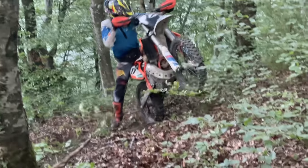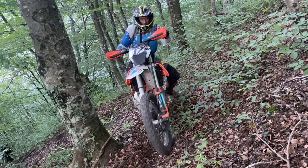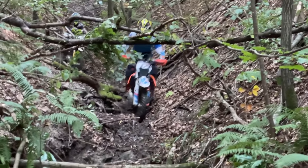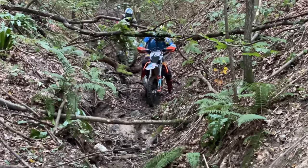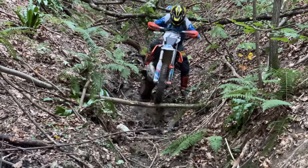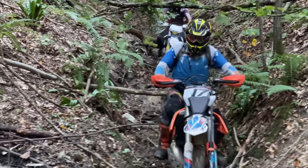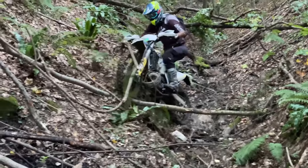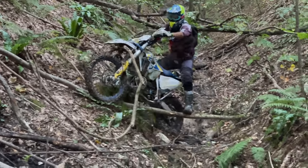On low pressure, your tire has less resistance to the ground and tire knobs can't make good grip on terrain. For stones it is great, but for mud it is not — the contact surface is bigger but it has a bad effect in mud because the tire knobs get twisted and don't work the way they should. I do not suggest using a pressure of less than 0.3 bar because of this. For slippery stones, this combination is perfect — keep that in mind.